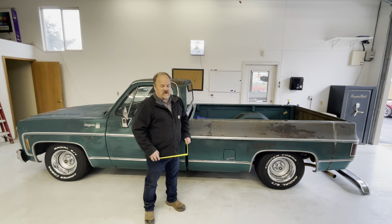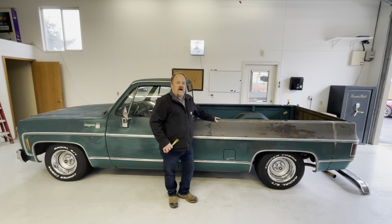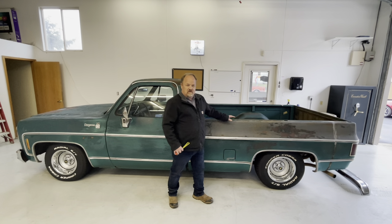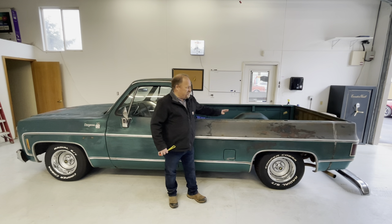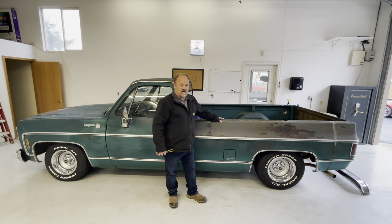I still like a short bed truck, so this is going to be a short bed truck. I just thought it was kind of fun to point that out, because we were talking about what is the right amount to shorten it. 14 inches makes it the stock length of a short bed, but you could take a little more or a little less depending on how you want it to look. We've had this for a week or two and I've kind of gotten used to it — it doesn't look that out of proportion after a while, but it is. We're still planning on taking 14 inches out.